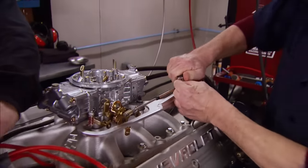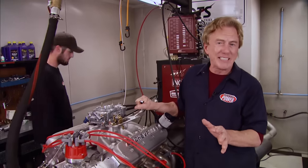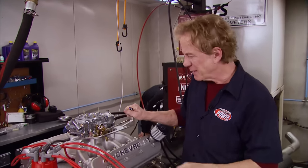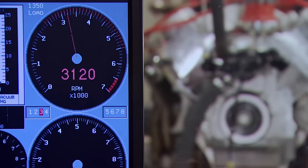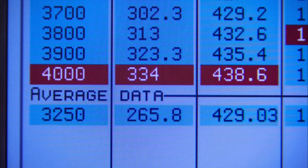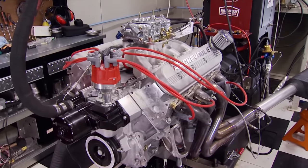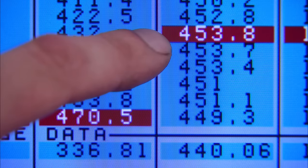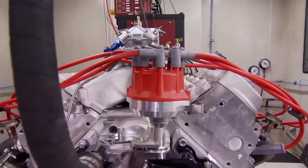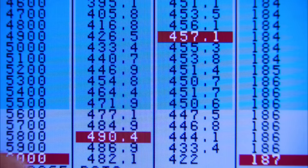As a point of reference, these later-model LS1 motors were rated at the factory at 350 horsepower and 365 foot-pounds of torque — that's the number we've got to beat. Taking it easy on the first run at 4,000 RPM, we're already close to the baseline on horsepower and already over the factory torque number: 334 horsepower and 438 foot-pounds. Stepping it up to 5,500 RPM, we see 453 foot-pounds of torque and horsepower still climbing at 470. One more run at 6,000 RPM — 490 horsepower and 457 foot-pounds of torque. In all fairness, this motor would have been run at the factory with all the front accessory drive and emissions equipment, which would have held it back a little — but not 140 horsepower worth.